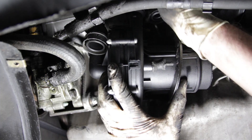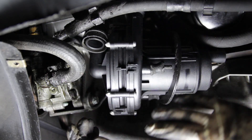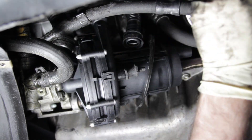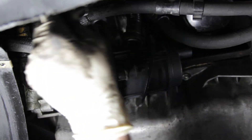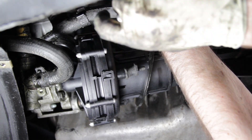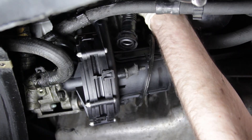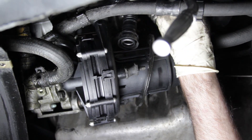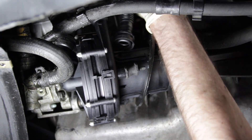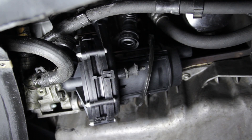Here we have it — our pump is in. We're going to get the 8mm for the bracket threaded in place before we start to mount up anything else. We have our lower bolts threaded in place. We left our ratchet up here and we're going to tighten the upper one back. Now we're tight.